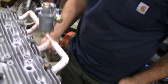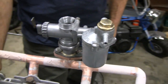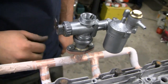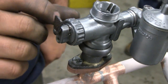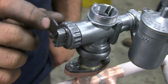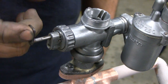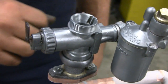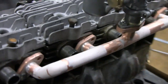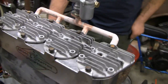Our buddy Mike cleaned that carburetor and it looks brand new. Mike shows us how it works: they don't have a throttle cable set up yet, but usually you have a cable going in here with a return spring inside. You pull the throttle and it pulls the spool open. This here is just a choke lever — a little pull rod. Once we get the throttle set up, we'll show you that. The intake manifold is almost done too.